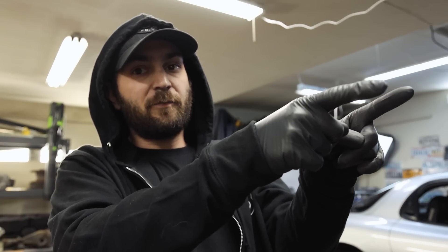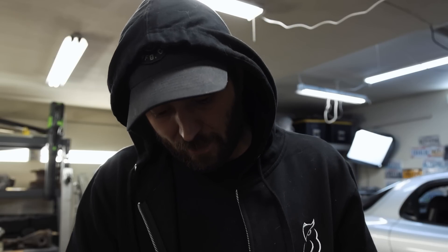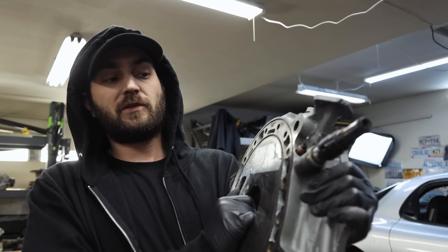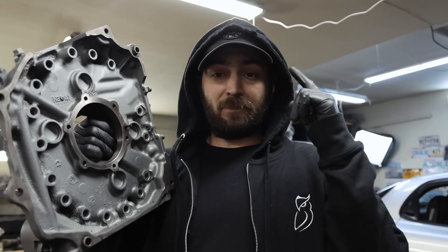Okay, we're a bit in the future — I've been doing some tuning on the Forester. On our irons, I had a major mistake on the rear iron: I got the porting done but blew through the exhaust port into the coolant chamber. I've quickly learned how expensive these irons are — you can't really buy them anymore. I had to buy a secondhand one off eBay, and there was only one available. Apparently it's different between manual and automatic, which I thought was really weird. I already got a new iron ordered — this is a $900 mistake. I learned that with this template, don't go all the way to the end of the template or you'll blow through into the coolant jacket.